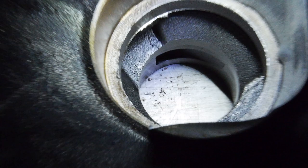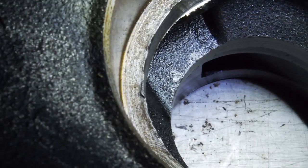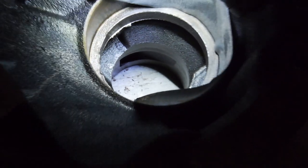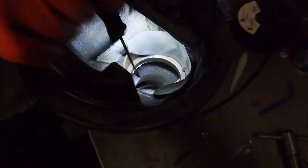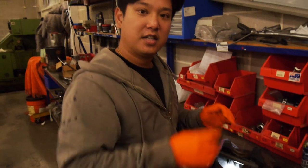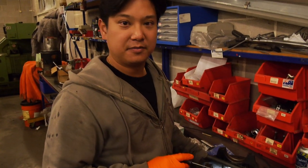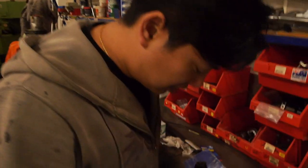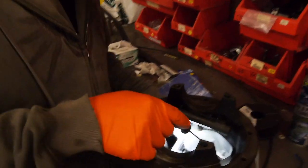Because the load is going to be pretty light compared to the service load. So when you're driving and you've got impact, the axial load is going this way down, that's why it's the biggest bearing, and it's going to sit high on that burr, and you set your bearing preloads against that. And then later on, what's going to happen is if you have really high loads, you can flatten the burr back out, and then you're going to lose your bearing preload because it wasn't sitting in the right spot. So this is just why it pays to check everything.